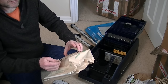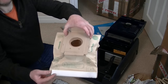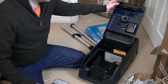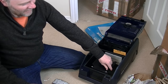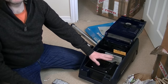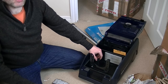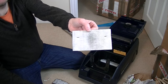Here's a genuine bag - this may be where the rice has come from. It fits the Alpina as well, Compact Elite, Vogue, Aria, Alpina, and Sensotronics - slide off clip, H7 Plus. There's a little device down here so I can't close the door without the bag fitted correctly. On the talking models there was a little magnet here that would make contact with a sensor - so on the talking version, if you tried to use it without a bag or with the bag not fitted, the machine would say 'bag is not correctly fitted' after playing a little bing bong.